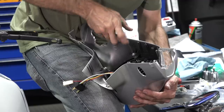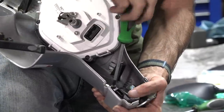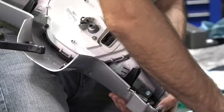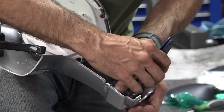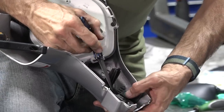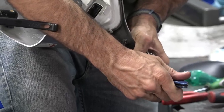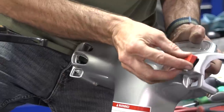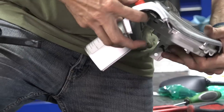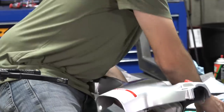Move on to the rear handlebar cover — getting all those switches replaced is pretty straightforward. The turn signal switch is the only one that requires a Phillips screwdriver and has washers. Take extra care threading the screws into the plastic because by now the scooter is old enough that the plastic is starting to get brittle. For the other switches, from the backside you'll find little tabs — use a small screwdriver or the tip of a knife to push the switches right out. Just snap all the new ones back into place; remember the order.